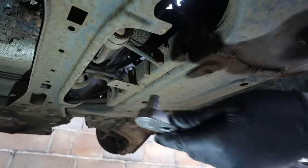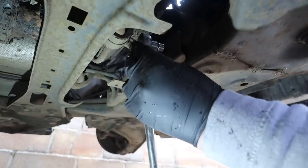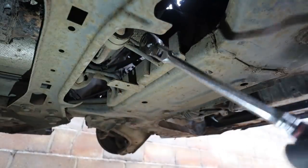Underneath the car, the first thing coming off is this exhaust bracket - the exhaust runs along there and it's held to the subframe by two 10mm bolts, one each side. I'll crack them loose - they're not very tight.